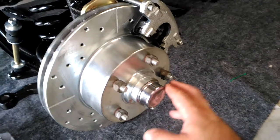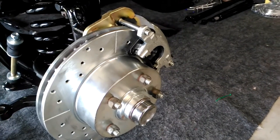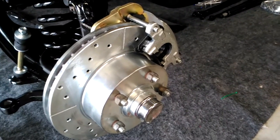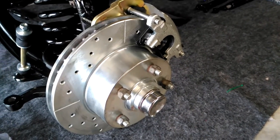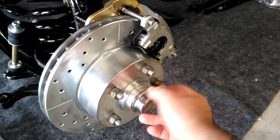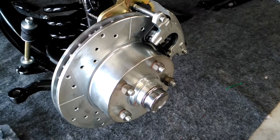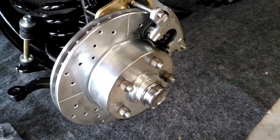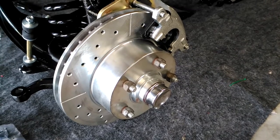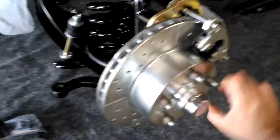The hardest part was having to redrill the cotter pin hole — that really sucked. I even tried the old castle nut and still couldn't tighten it far enough to get the cotter pin through. So I had to redrill it, broke a couple bits in the process — just a real headache. But I was able to get it done and it's pretty tight now.